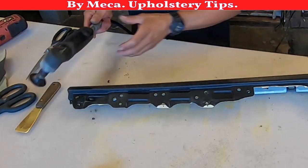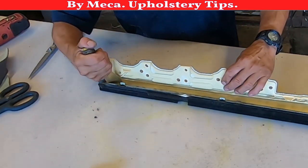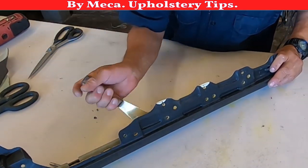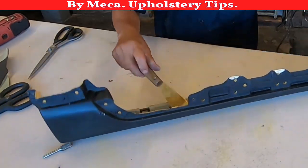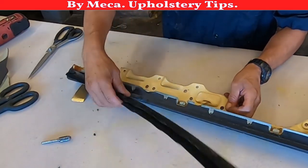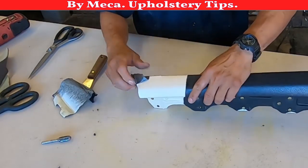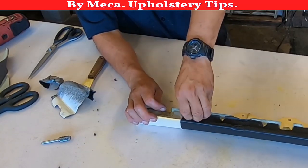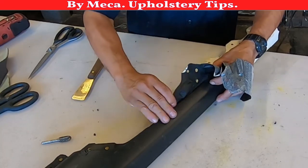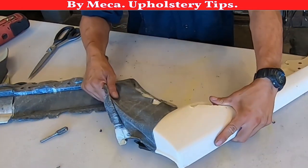I got this door panel piece right here. Now you can optionally put a quarter-inch foam on top, but honestly I don't like to put foam on these pieces. First I'm going to remove this little gasket. It comes with metal tabs — you just have to open those metal tabs a little bit with a spatula or screwdriver. Most of this kind of car comes with metal tabs, but some come with rivets. Now I'm going to remove the vinyl. A lot of people put new material on top of the old vinyl — I don't like to do it that way. I like to remove everything. This is the same process for Toyota, Honda, and Nissan.